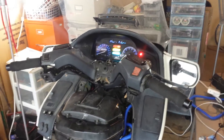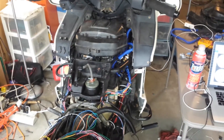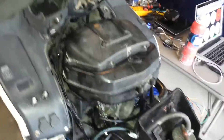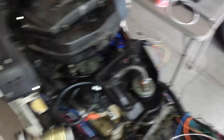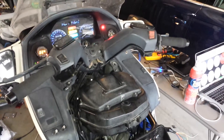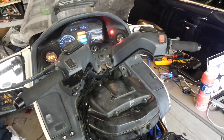It feels good that it actually might work. Now I'm going to have to start the tuning process to get it to run reliably at idle, then look at running at different RPMs. At that point I'll finish tidying up the wires. I'm also going to put an idle air control valve from a VW or Audi — one of these Bosch units I've been modifying — that's going to tuck in there somewhere for idle air control in the future. I'm pretty excited about how well it's turned out so far.